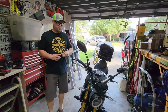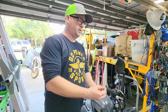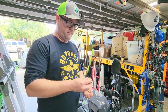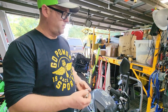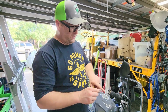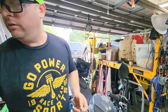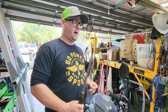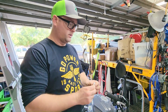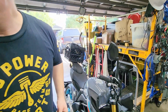So come on over here and check out how this is put together. These are the normal bar ends that come on your stock Freedom Fighter. They look really sharp. They're aluminum, and they look good, but we got to take them off because we're going to put these bar end mirrors on there. Inside the bar handle itself is actually threaded, and this is what's inside there. It has a large slot, so you do need to get a wide flathead so you can engage it and not booger any of your surfaces here. But this is threaded inside the handlebar like this.